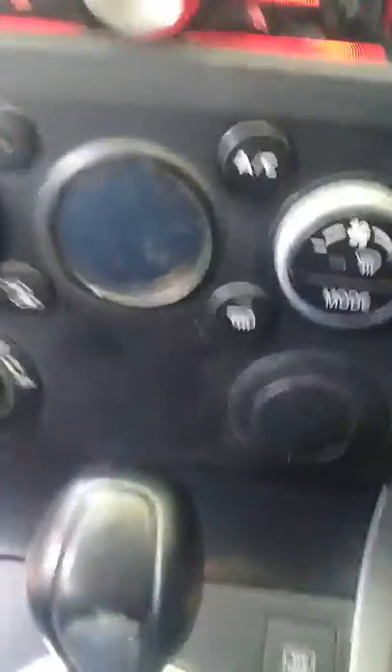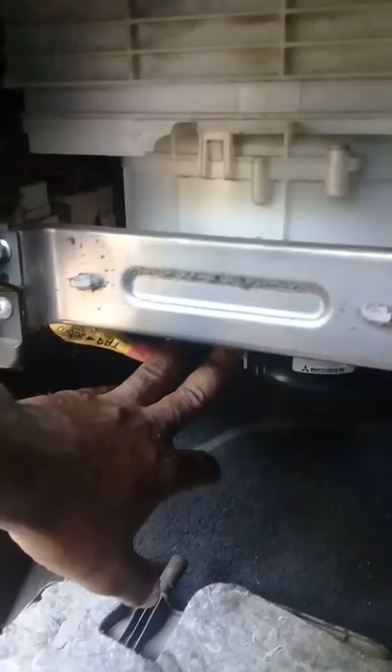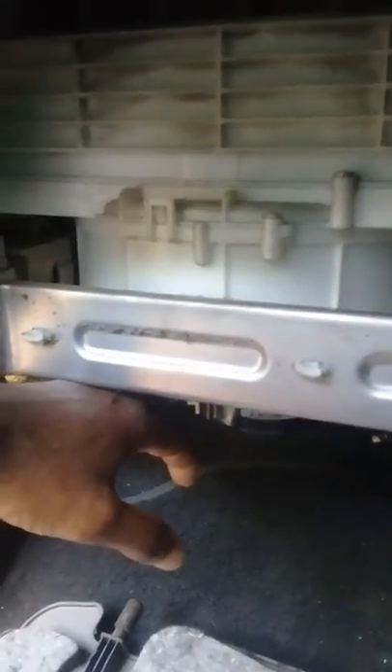Turn the engine off. The power stage of the blower is located right here. This provides the grounds for the blower motor. We're going to check to see if there is positive power going to the blower motor, and negative going to the blower motor, which should allow the blower motor to turn. If there is an absence of the negative, then we'll proceed to check this — which is the power stage, which supplies the negative for the motor.